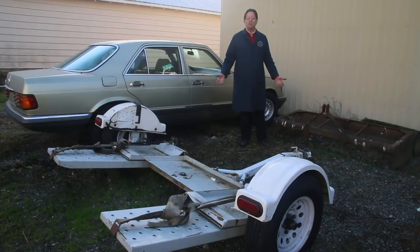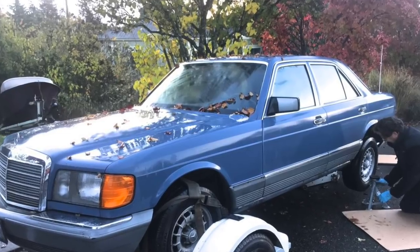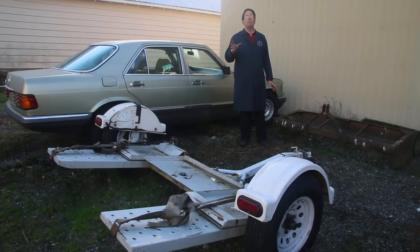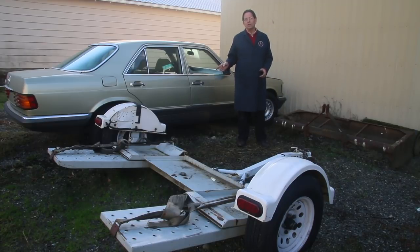This is the kind of misinformation and misunderstanding that can be quite dangerous. There have been instances where people tried to tow these cars backwards and the trailer completely went out of control and actually flipped the car over, particularly if it's a lightweight car. When towing one of these heavy Mercedes diesels, you don't want to be towing it with a towed dolly with any car less than 4,500 pounds — you need the weight there.